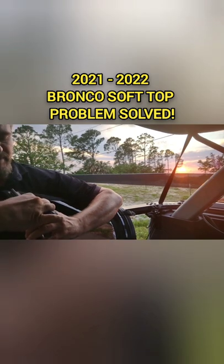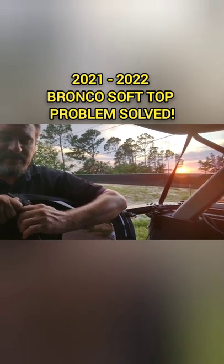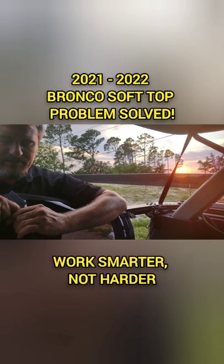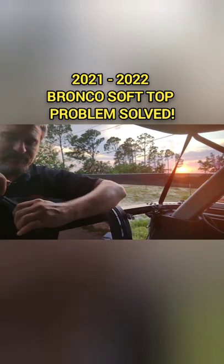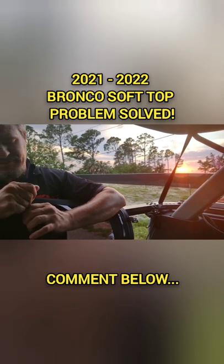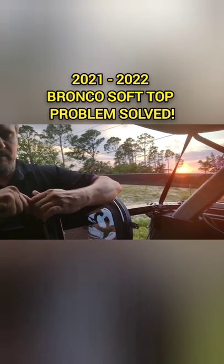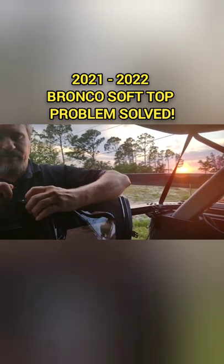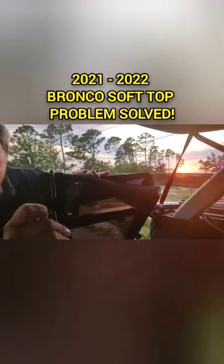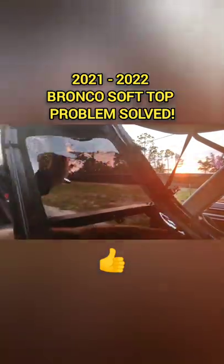I'm just gonna round these tracks off just enough to put a little round edge on them, and you'll see it's gonna make a huge difference putting the track back on. I know doing this is not going to compromise anything on the track — all it's gonna do is give me a better angle to insert it, and this is gonna make everything so much faster putting the top on. I'm just gonna do every flat side there is, that way whichever angle they get put in, it's not gonna matter. All this is is the little plastic rubbery piece that starts in the track. Now it's a round surface versus a flat hard edge — I'm gonna do it to all three windows.